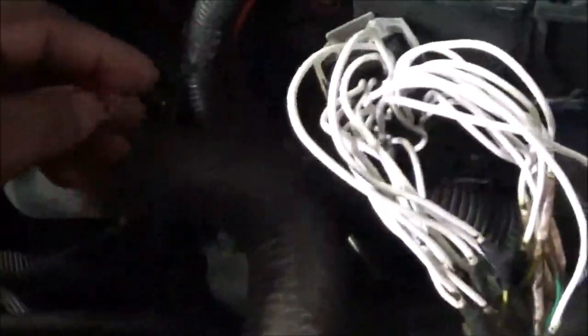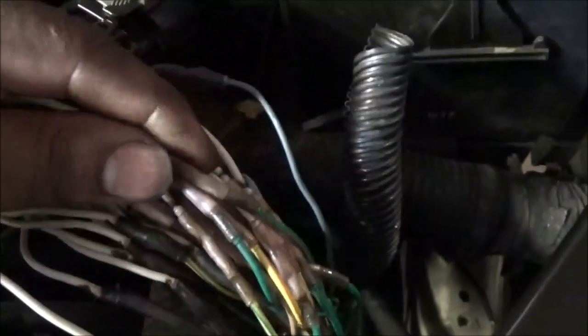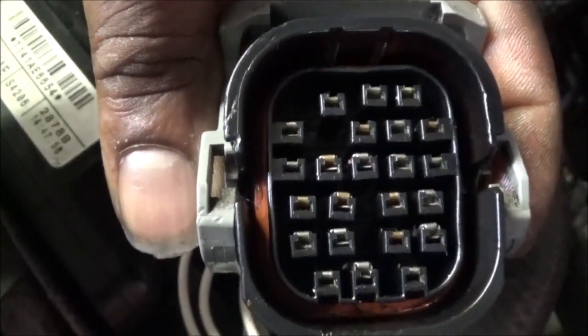On this 09 van, I finally finished redoing every single one of these wires. As you can see, all this white wire — some I used butt connectors and some I soldered. The ones I soldered were the smaller wires so they wouldn't have a chance of wiggling inside the crimp. The bigger ones I just used the crimp-and-shrink butt connectors. So I did every single one — there are 23 of these things.